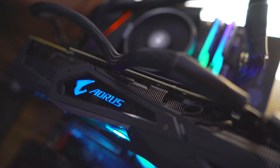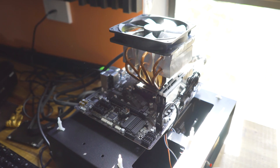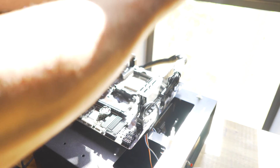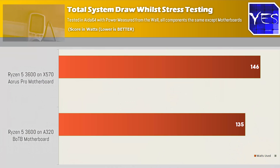A combo like this is a great solution for a one-time PC build — it's going to last you for years to come. This motherboard has USB 3, PCIe NVMe x4 linked up to the CPU, and overall uses less power. From-the-wall stats in Aida64 showed around 135 watts versus 146 watts on the X570 board — about 11 watts less in ideal conditions.